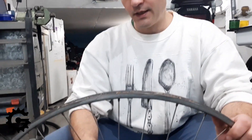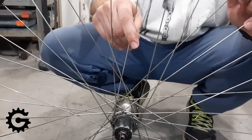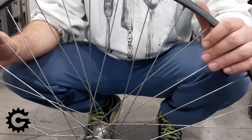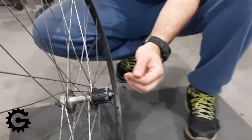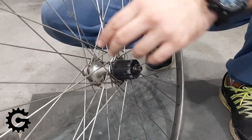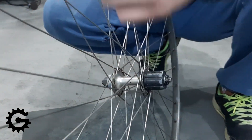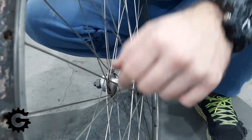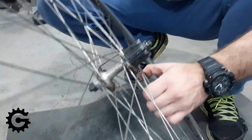It's simple mechanics and elementary geometry. I will now explain another reason why spokes are laced the way they are — because they are all at an angle and interlaced among each other. On some wheels, especially modern hipster front wheels on fixed-gear bikes, you can see them placed radially where the spokes go straight up to the spoke hole without going at an angle and without being interlaced. What is the problem with that?